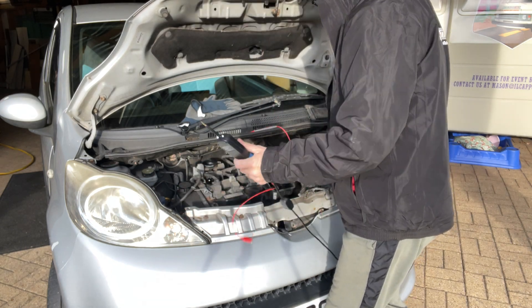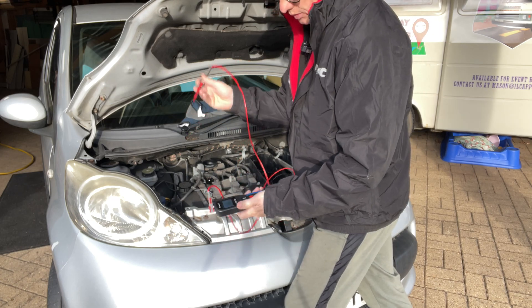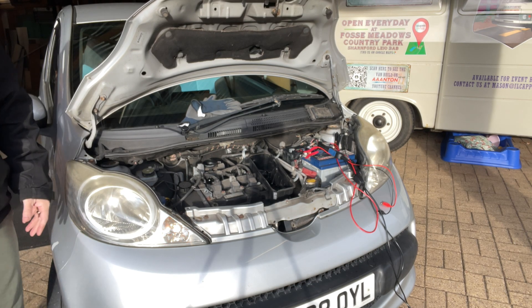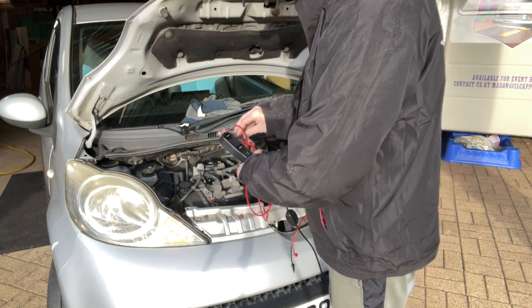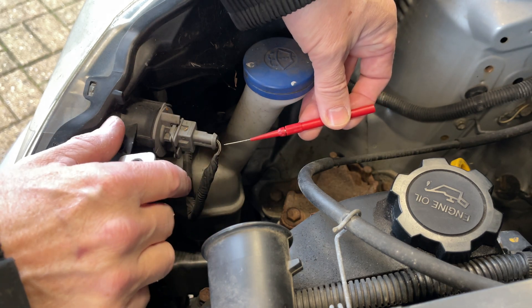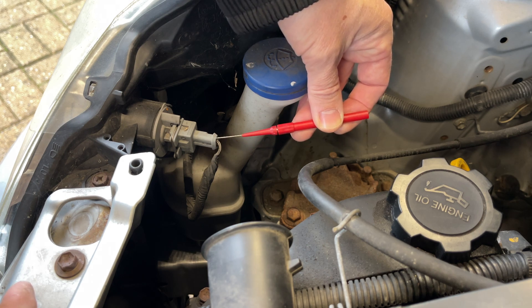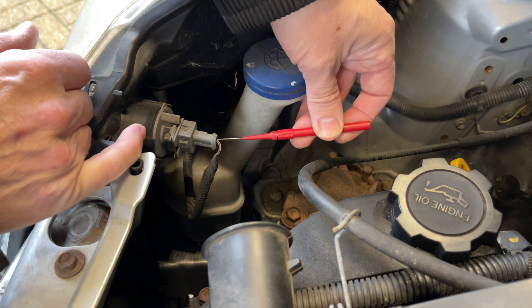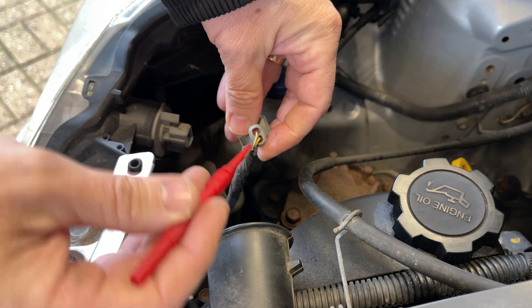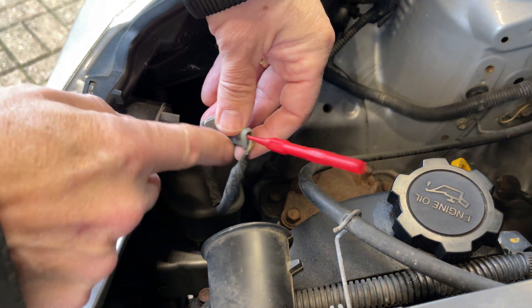The other thing we can easily check is your bulbs. If you've got a bulb that's not working, we can get the probe - I've got my little pin probe there - and we're on voltage. I'll just pop the indicator on. When we're probing into connectors we really want to be sure that we don't pierce through the wires wherever possible. If you pierce through a wire the chances are you're going to get water ingress and it will corrode back down and cause a problem. But what you've got behind these plugs is a little rubber sheath, and we can actually use these probes to go down the side of it. You'll get your test without damaging the wire or the seals.